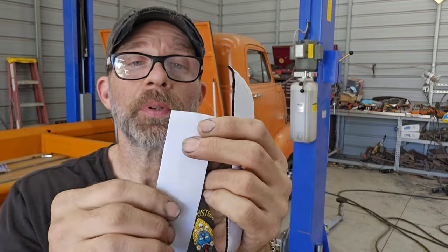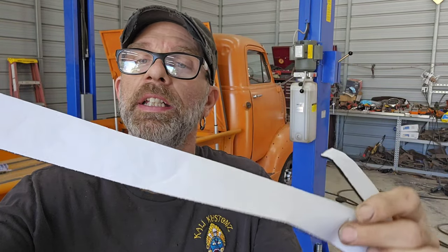I got a roll of felt, and the backside is super sticky, and I cut strips an inch and a half wide. Then I placed it all along the perimeter of those panels. When I tighten it down and tap it, no more noise. This works great for a lot of things, not just vibrations. If you have a center console with that felt inside, you can cut a piece of this and lay it down in there so it's nice. That's what I did on my 3100 build.